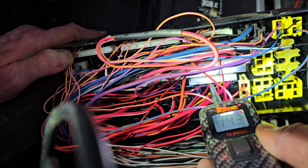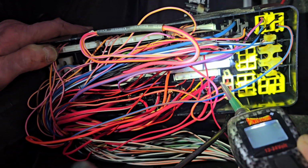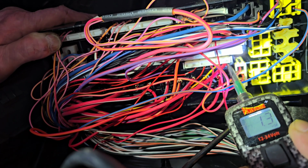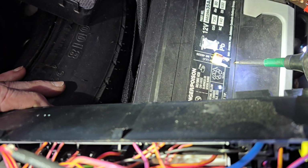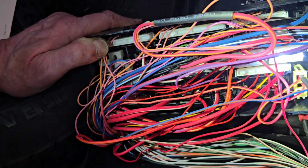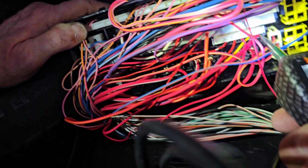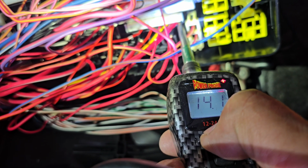So if I go to the fuses, they all have power. So those are the power. This one, I have no power because, as I said, we got this fuse taken out and it's also burnt up and blown, as you can see. So temporarily, what I'm going to do is I'm going to shoot power right here. So I'm shooting 12 volt in. See that?